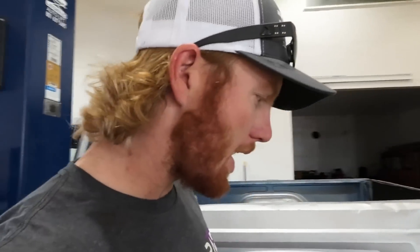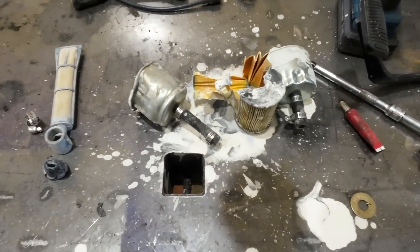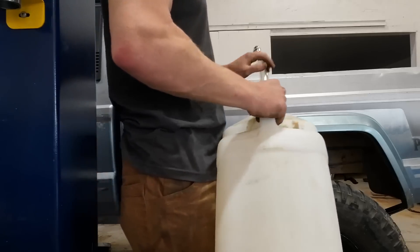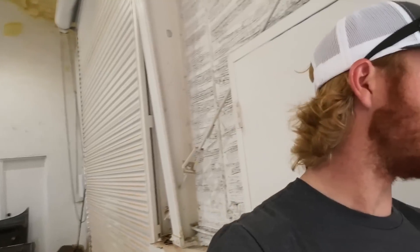Good morning — I'm back at the shop. I have a new fuel filter and some Seafoam, because it works. Crazy that was in there. I just realized I left the key on all night long — hope the battery's not dead. I'm going to get the lines blown out really quick with air, then throw the tank back in, put some fuel in it, and listen to that engine purr. Man, I hope this works.